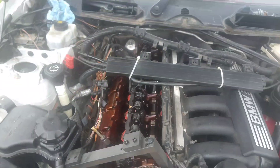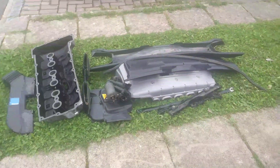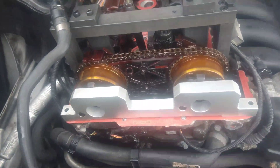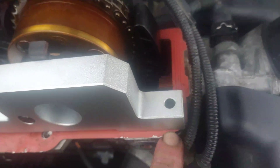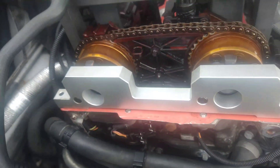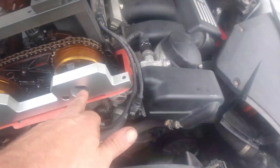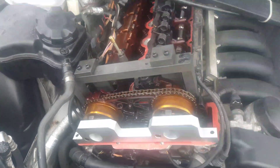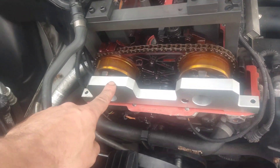I'll see if I can adjust it - you do have to take quite a bit off though, all of this that you see lying over there has got to come off to do it, it's a bit of a nightmare just to check the timing. Managed to align it up - that's how it should look, so that's in there flush. There's a dowel here and these two points go into the sprockets at the front. That lines up, it's all in time. I'm going to tighten them, turn it two turns round on the crank, see if the pins will still go back in. There's my TDC mark - twelve stripes. If it all lines up I'm going to build it up, but that matches the fault code - the exhaust one was out of time and that's what the fault code was.